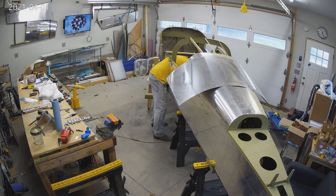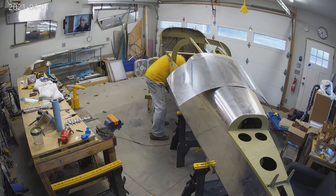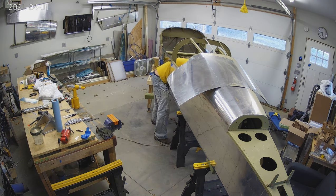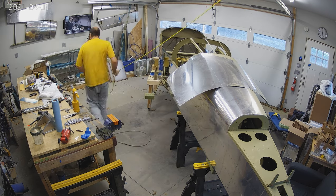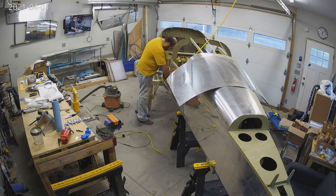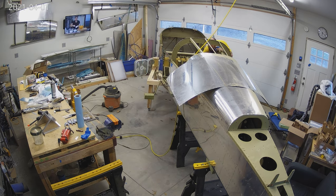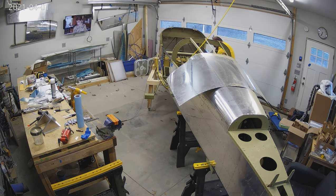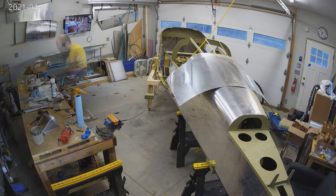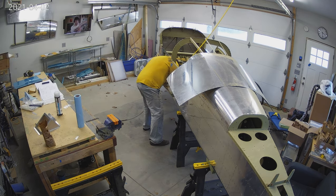There's a ton of wires and tubing that have to go from the rear fuselage all the way forward to the panel. To get through that section right there, we're running unsplit conduit - I believe it's three-quarter inch diameter conduit. So a lot of drilling holes and putting mounting brackets to make it fit and make it sturdy, so that it's not vibrating and rubbing on things and just causing mayhem back there. That was a good chunk of what this past week was.